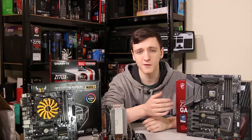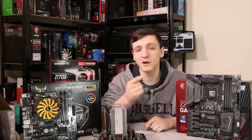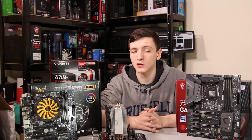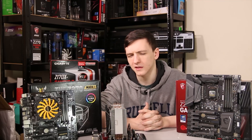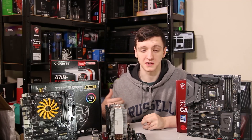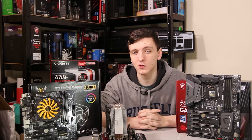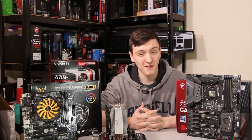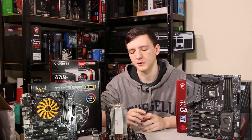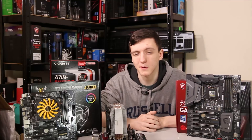The MSI M7 has a nicer BIOS, but for £30 extra that money could go toward a GPU upgrade instead. Also worth mentioning: older Z170X Gaming 7 boards from Gigabyte technically support seventh-gen CPUs but require a BIOS update, so be careful if you buy a board manufactured before that update was applied — it won't work initially. That said, they do still work, so you can snag a bargain on older boards that still feature USB Type-C, NVMe, Thunderbolt 3, and similar feature sets.